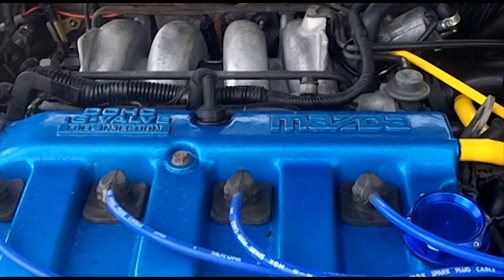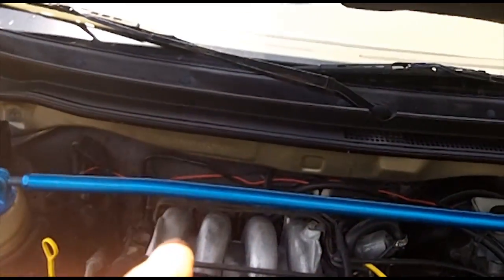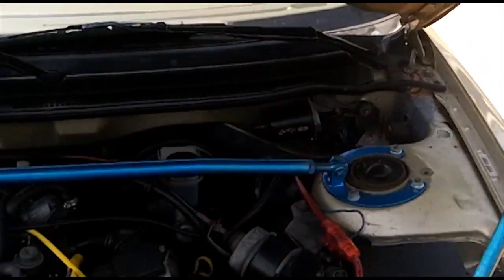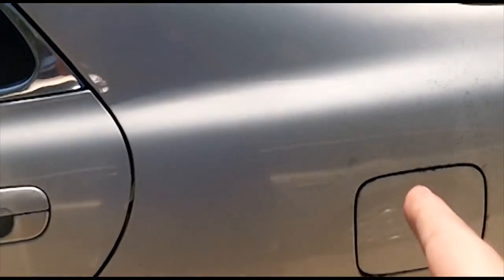If you have a bad Purge solenoid, there is one thing that you can do. So let's say that your Purge solenoid stops working, it's not venting fuel vapor. And like I said earlier, you have a secondary line that runs up to your filler neck. So one thing that you can do is kind of just barely loosen your gas cap. All of that fuel vapor will then vent out of your gas cap.